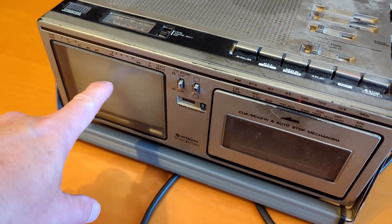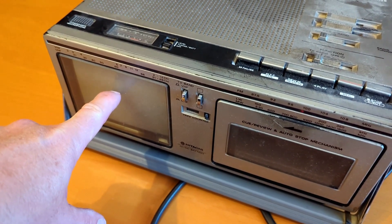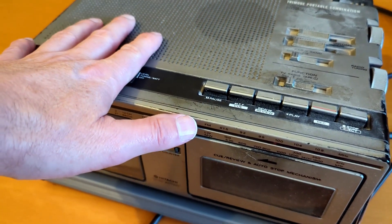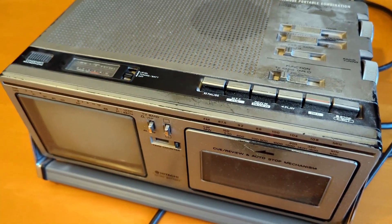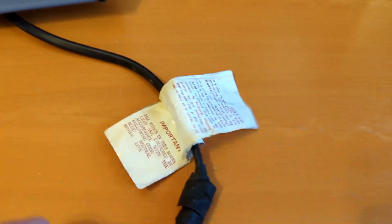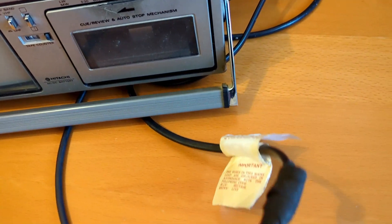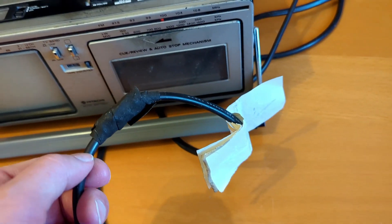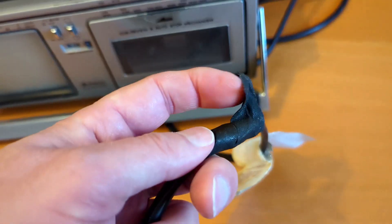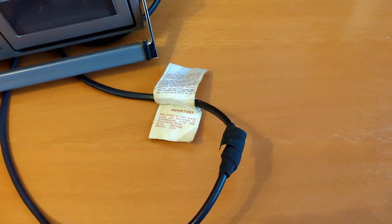The one thing I'm worried about is this is a cathode ray tube — a CRT — and it has been turned on, and I don't know how long the voltage will be in there for. I don't want to blow myself up if I take the cover off, so I have to figure out what the process will be to fix this. The first thing I will have to do is replace the power cable — he's put an extension cord on this just by connecting the wires up to a longer piece of cable and putting some electrician's tape on, which is falling apart. So that's one thing I'll do quite soon. Thanks for watching, I'll see you in the next video.